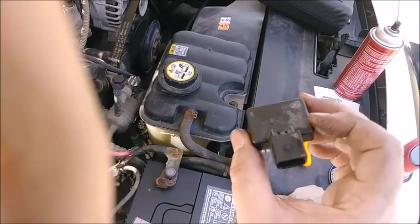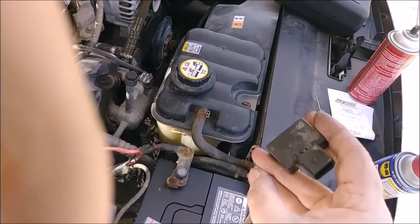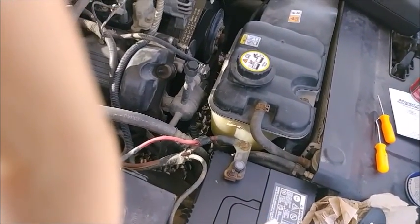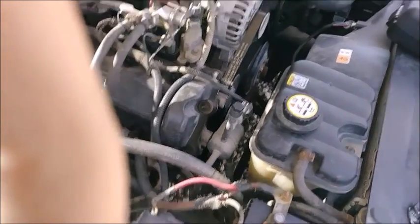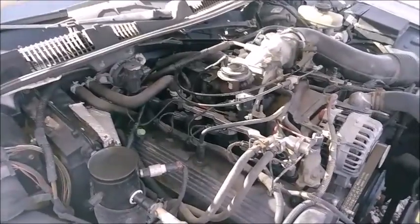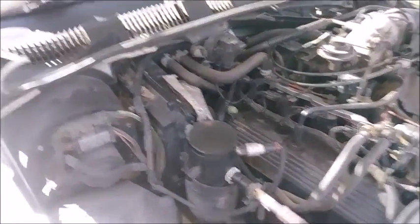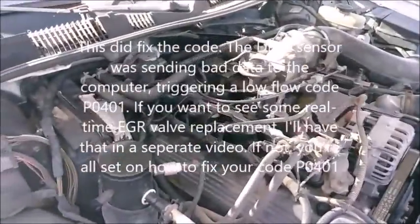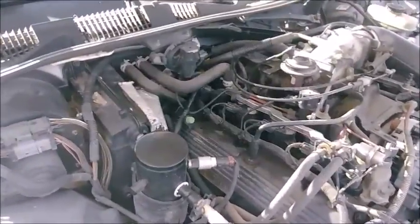The new one is a slightly different design - it's bigger, wider than the old one. Not sure if that's because it's aftermarket or Ford redesigned it, but the electrical connector does attach and the hoses stay secured on there, so that's good enough for me. Go ahead and clear the code, scan it to confirm, and that should be it. The solenoid is good, the valve is now cleaned, and the suspect pressure sensor has been replaced - should be golden now.